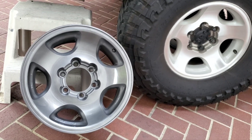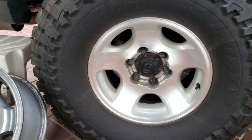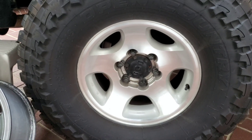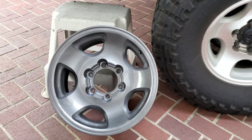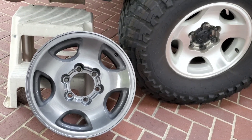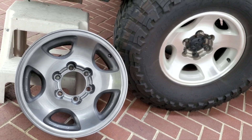You cannot powder coat these, so you need to do an epoxy primer first. You can't really polish them either — it's clear coat, not bare aluminum, so they'll clean up but scratches and pitting you'll never get rid of until you paint. There's the finished product. Subscribe and check out my other videos in the description on painting, polishing, and getting rid of rust on wheels. Thanks for watching — happy trails!